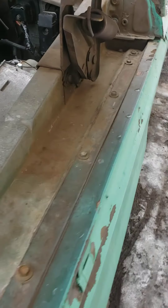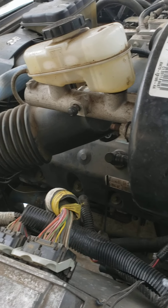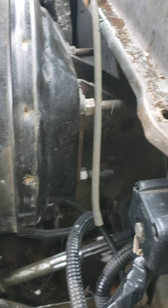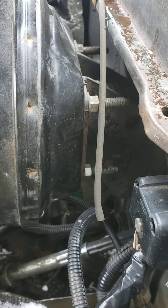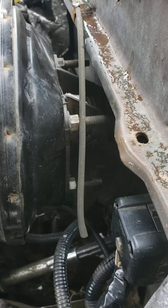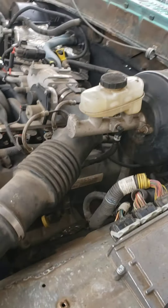Kind of show the brake stuff a little bit — it's hard to see, but there it is. That's the Crown Vic master cylinder and booster, and then that is the power brake adapter that came on this truck because it had power brakes. I just had to cut the ears and move them out a little bit further and it fit up really nicely.